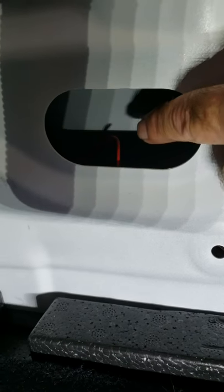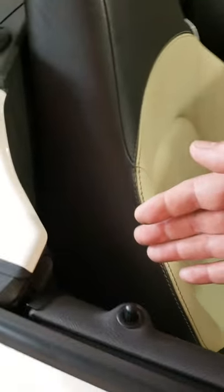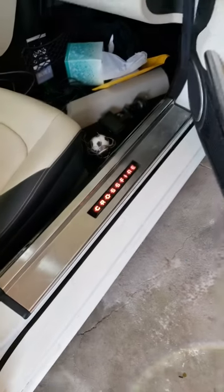We're going to drill a hole through the backside right in here and bring the wires inside. Some people go through the vent on the side, but if you do that, some connectors end up underneath the bumper and you can't get to them later. I think coming through this hole and putting a rubber grommet is a better option. If you're hardwiring it, you'd go through the vent over here, run it along the side, and then down underneath the carpet.